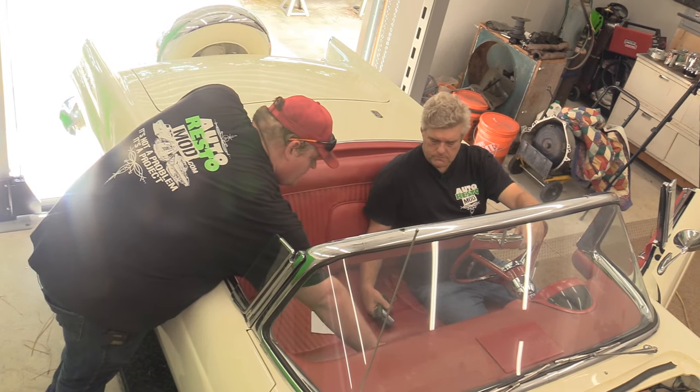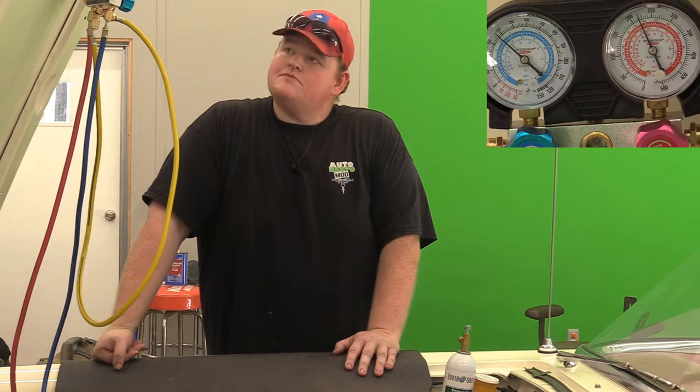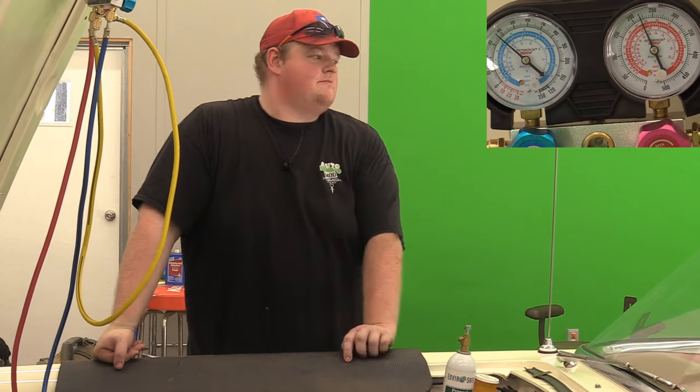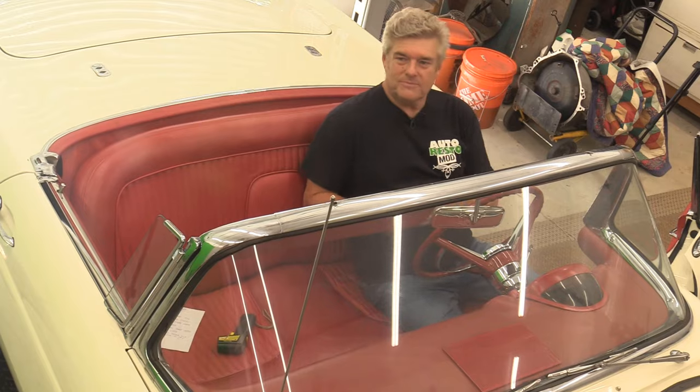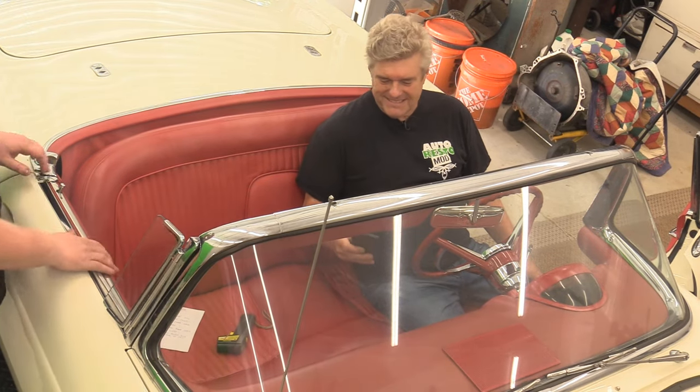I think that EVAP might be a little weak. It smells like shaving cream. This will be fun for 30 minutes - we get to sit around and do nothing. Welcome to the fun of AC work. One hour vacuum, sit on a bucket, look at memes.